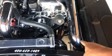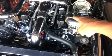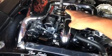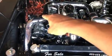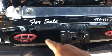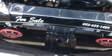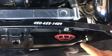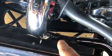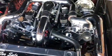The air comes in through this custom four-inch intake tube into the supercharger, out that pipe — these are made out of TIG-welded aluminum three-inch tubing — through here into this air-to-air intercooler. This one is actually designed for a very large turbo application because it's so hot here in Arizona; like yesterday it was 110. Then it goes out through here.